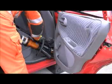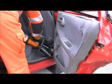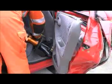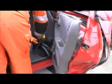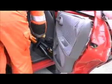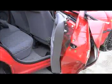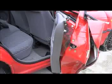What you'll see we're doing now is ideally a horizontal cut into the base of the B-post, which will start to form part of our tear. Obviously it is very restricted space and you're not always going to get the tool in dead horizontal to make the cut, especially when we have to avoid items such as a seatbelt pretensioner and any SRS systems that might be in the base of the B-post.